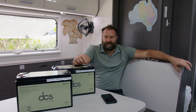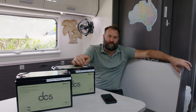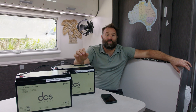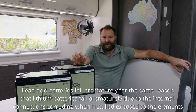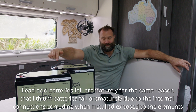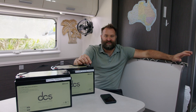It's also not as simple as just mounting the batteries externally, because you need to follow manufacturer's IP ratings. For example, IP54-rated batteries can't just be put outside externally because you will void the warranty. The same reason lead acid batteries fail is the same reason lithium batteries fail prematurely — due to ingress and external conditions. Ingress will eat away and corrode the battery cell connections in a lead acid battery, and exactly the same thing happens in a lithium battery. The mechanisms, the welding, and the connections internally are very similar.